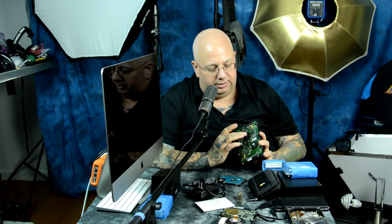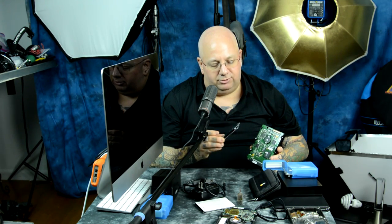This is why I have copies of a lot of the same stuff — I've got a lot of copies of this specific Toshiba model. The two points of failure on a naked hard drive: first is a head crash. These are the heads connected to the voice coil on the armature. Those crash, and what you do is replace the armature. Second point of failure is the hard drive controller board — this green board on the back. The screws on a modern hard drive make it very easy to replace.